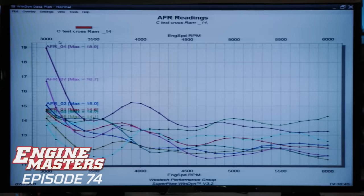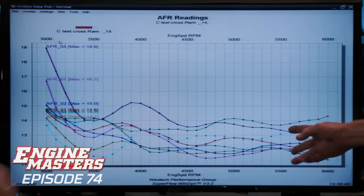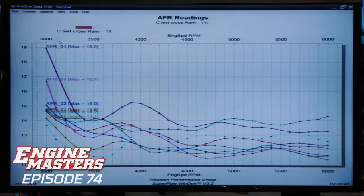Your opinion, please. Let's look at air fuel. I don't want to look at power yet because I'm already blown away by the air fuel. I want to look at power later. Ooh. Much tighter and no big outlying cylinder. The range here is 14 to 12. This is just one at the end. Well, I'm looking right here. Yeah, right in here. It's literally better than most of the modern single or dual plane single four barrels. It's really surprising.